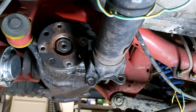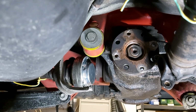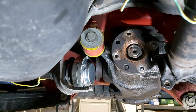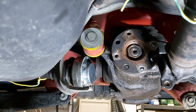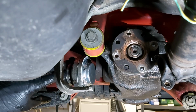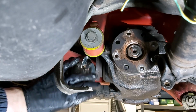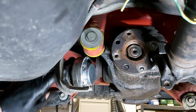The one thing I would take out of this so far, and I've discovered this along with you today, is I would definitely recommend covering the rubber boots on these drive shafts. Give them a spray with silicone before you put the socket wrench in there, so that there's no chance that they get damaged. Just make sure you've got no sharp bits on the shaft of the socket wrench that you're using, or the actual socket head, because you wouldn't want to nick one of these boots. Quite honestly, I believe you can replace them, but you've got to get the universal joint off the end, and that is one monstrous job from what I've seen. I've watched a few videos of people doing it, so you really don't want to get involved in that. So do what you can to protect these rubber boots.